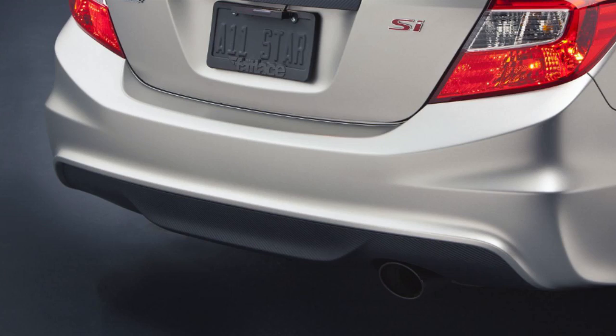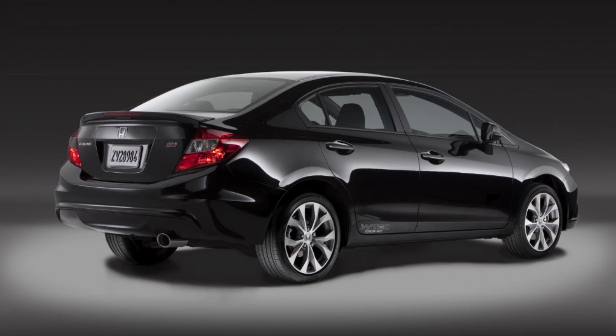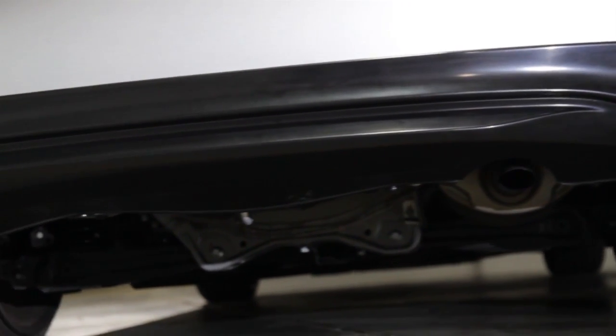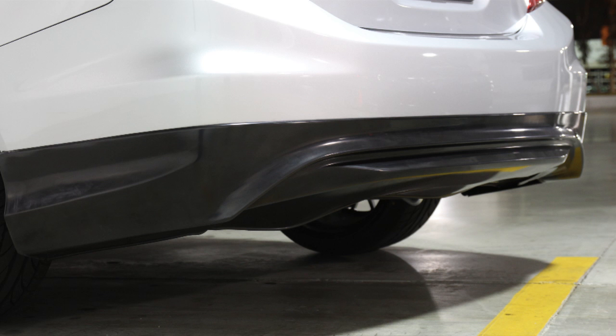For the rear lip kit — it is initially designed for the Honda EX and EX-L, not the SI. Because of the rear diffuser on the SI, the kit will not work. The kit came wrapped just like the front lip and opened up in pretty good condition. There was a slight wave on the bottom, but I left it in the sun and it came back into shape. For mounting, I reused the holes from the mud flaps, aligned them with the rear kit, and screwed it in. You will also have to apply a secondary screw into the rear bumper. On the bottom, there are two additional areas to screw in, and the long section in the middle gets 3M tape. I did both — added the 3M tape to stop drag from underneath the car and bolted it in with self-tapping screws.